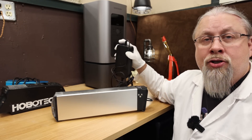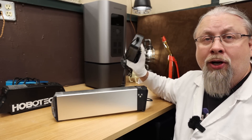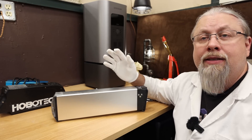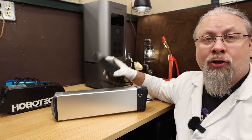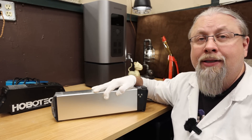This is the standard battery and charger you get on one of those cheap Rad bikes. Most of these chargers are only one to three amps and are designed for a slow overnight charge. Sometimes the brand will offer a speed charger that can do up to five amps. The best and safest way to charge your electric bike battery is simply using the charger it came with. If you know what you're doing, you can get a faster aftermarket charger, but for this example, let's keep it simple.